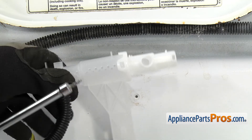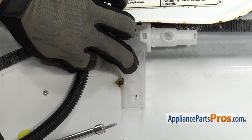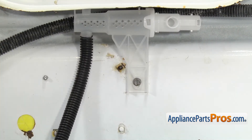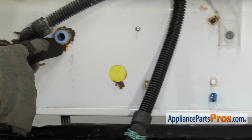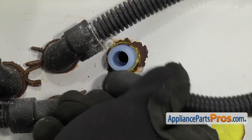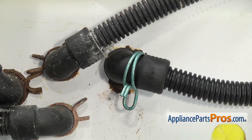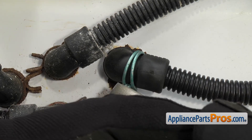We're going to put the water nozzle on first. We're just going to line it up and use the quarter inch nut driver to put the screw in to hold it in place. Once you have that screw tightened down, we can reconnect the water inlet hose to the water valve. You're just going to have to bend it over and press it onto the water inlet valve fitting. Once you have it bottomed out, we can use our pliers to compress the clamp and move it down so we get a good seal.